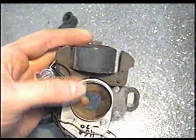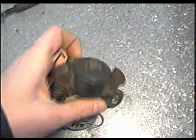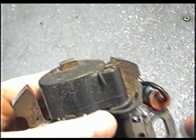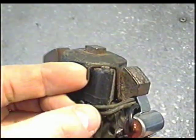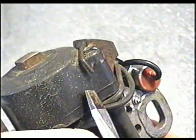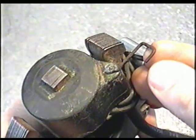To remove the coil you have to remove it from this metal plate here, so the coil will come off from the center. First, you have to remove the pin that is holding the coil to the metal bracket. Grab yourself a good flat screwdriver and just tilt the pin over and move it out of the way like this.